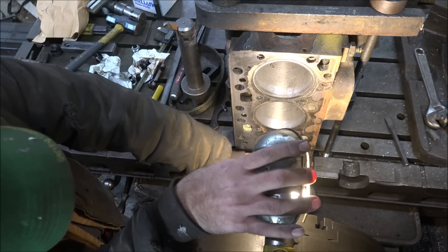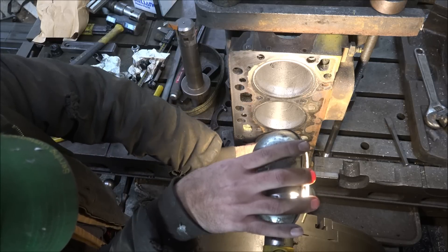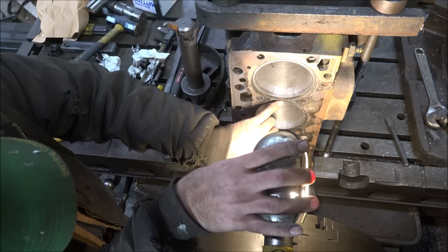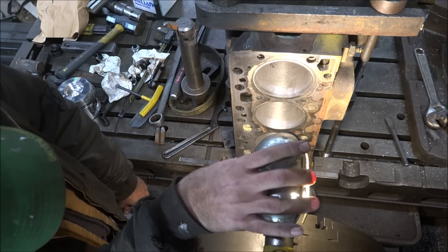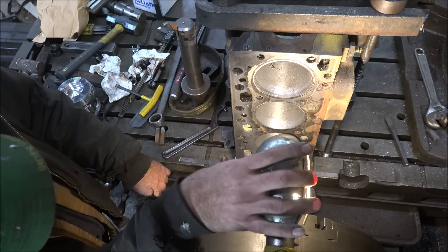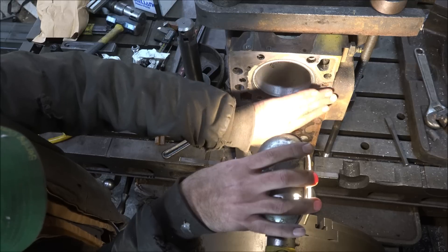It's particularly low in the middle of the deck — way low there. It looks like a head gasket may have been leaking on this thing, probably blowing in between the two. Five thousandths off this really didn't do much for cleaning it up, but take another five and see what that looks like.